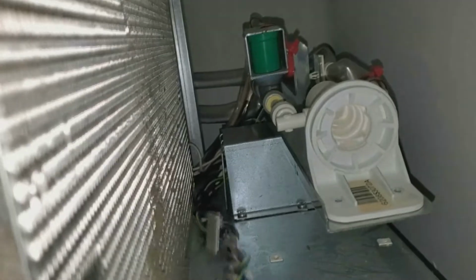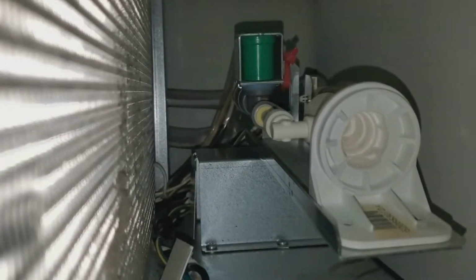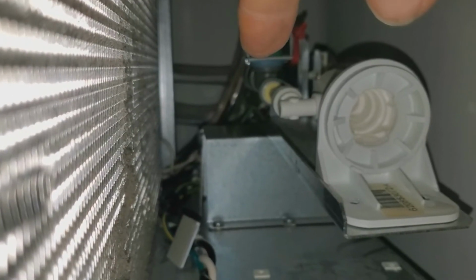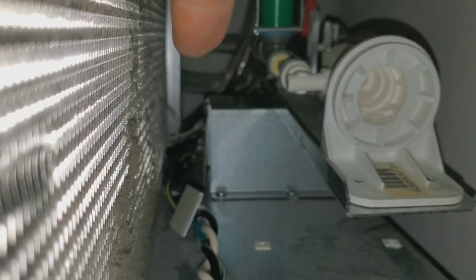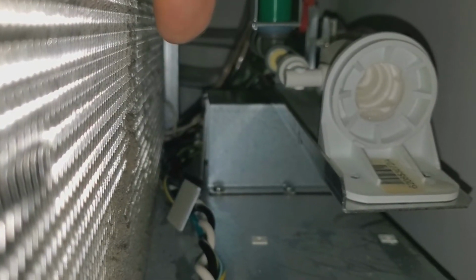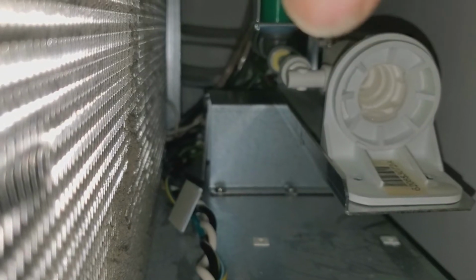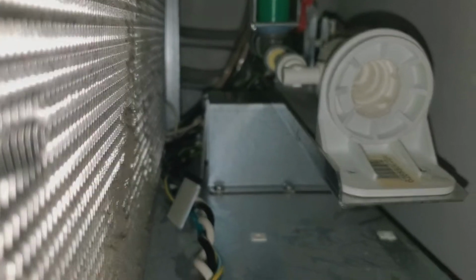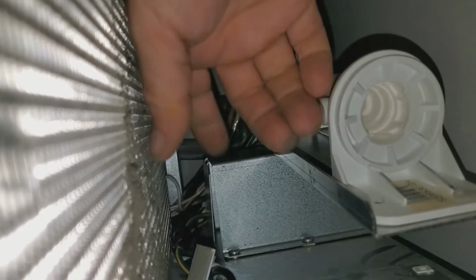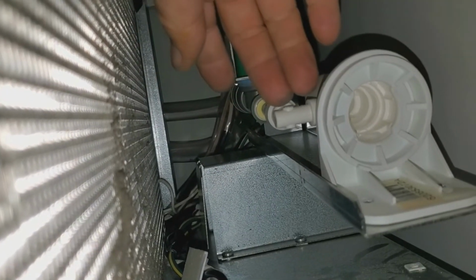You are going to want to take note when you're doing this. When you pull out the plug and you lay it up on top, you're going to see it's got 6 terminals on it. That flat will be on the top left. So you're going to plug your harness in accordingly, and then the jumper that comes off the harness, make sure that the flat is on the top left. When you reach around that and find it and plug it in, if you have it flipped around the other way, you'll be there all day long.